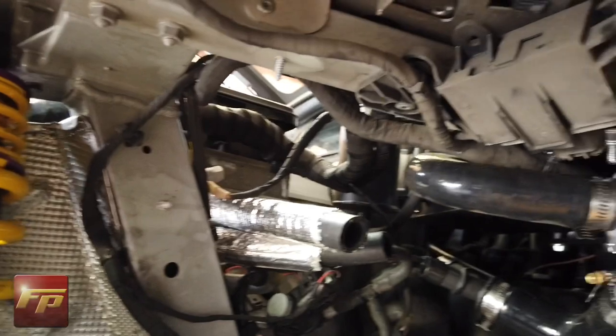That's pretty much a wrap for the second video in the series. What we accomplished today was installing the turbochargers onto the manifolds, getting all the turbos clocked and rotated, running the oil and coolant lines to and from the turbochargers, and installing a portion of the intercooler system — the expansion tank, the water pump, and some of the associated lines. Greg just has a little minor wiring to do on a few harnesses to make sure everything reaches. On the next video you'll see us move around to the front of the car, take off the front bumper, and mount the heat exchangers and more as we make our way to completing this build.